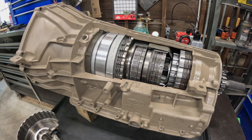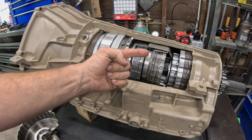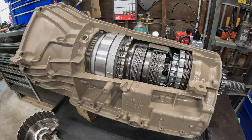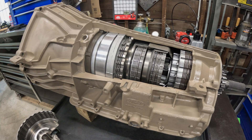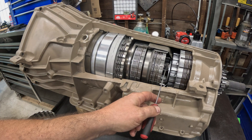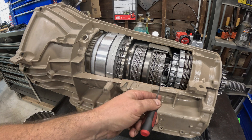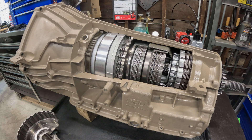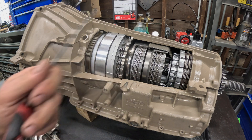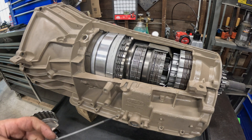The shell was from a truck that had a catastrophic forward planet failure, so there was a lot of scoring and gouging on the inside rear surface of it. From time to time those shells will break right around the sun gear. So in this case, I felt that it was weakened, it was ugly, it was scored, so I was never going to use that shell. The forward planet is just a three-pinion aluminum job and there's nothing wrong with it. The ring gear, which is also cut open, is actually the ring gear from a previous video in the bad parts series where I show the forward ring gear with all the damage to the top lands and the faces. That's actually it right here, and it works fine for this — not usable anywhere else.